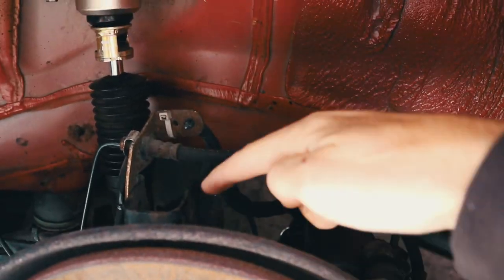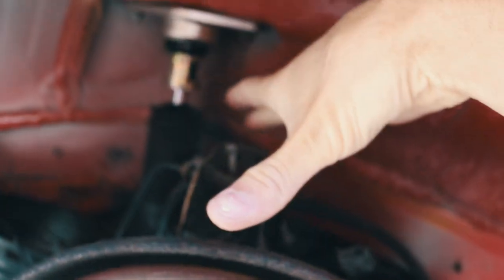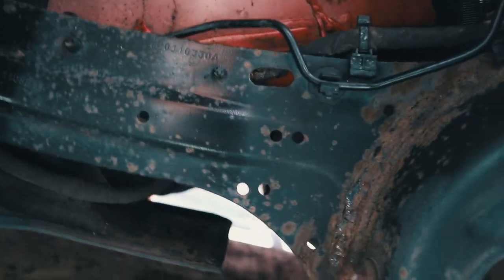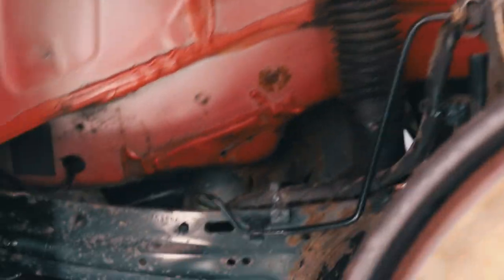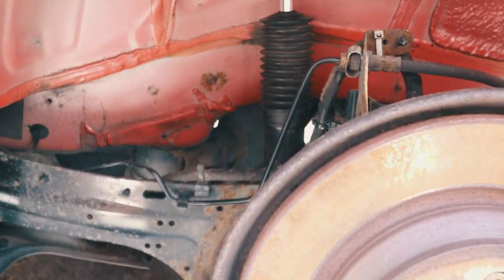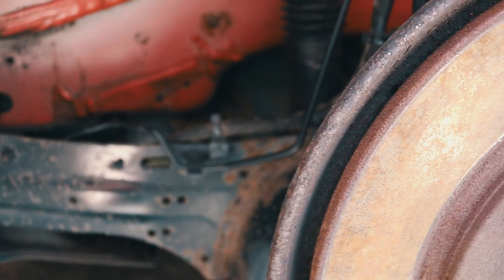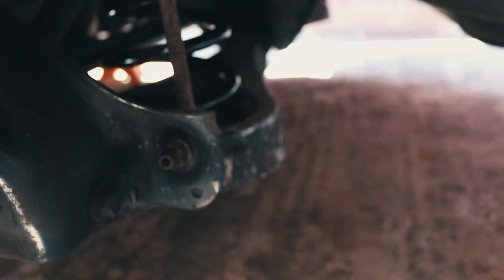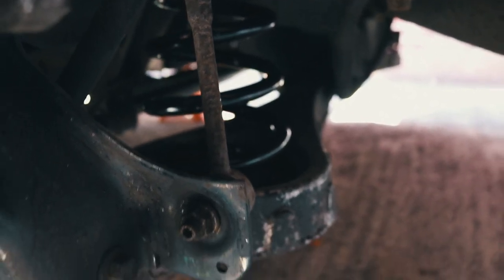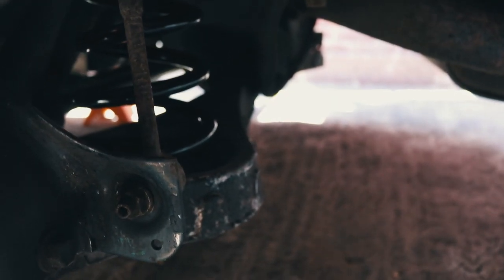So I've got to take this arm out here — just this pole at this end and there's one up the other end, and this sort of adjuster camber. There's a tail arm here that you can get replacements for but I've been told you don't need it, so I'm not gonna bother yet. If I do need it I'll probably just make my own ones, because they're like £100 for literally a straight arm. So yeah, I'm just gonna buy a stock pair, weld in some threads and make it all legit. For the rear suspension, because I've got 16k springs on the front and 8k on the rear, it's gonna be a bit horrible, and plus if I want to fit these Weds wheels I need a bit stiffer.